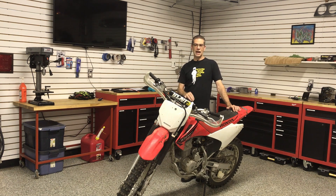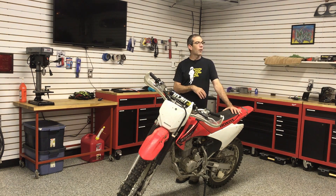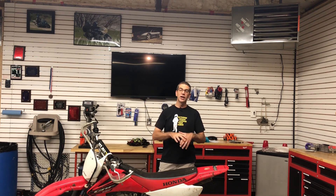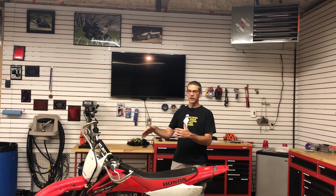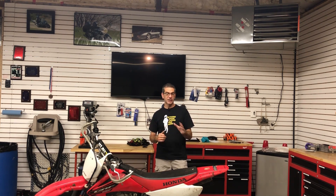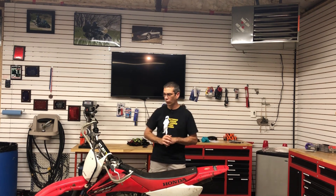The key here is simplicity, and that simplicity lets you focus on your riding skill. The bike does have a rear drum brake, so it's not ideal for locking up the rear and learning to slide, but the drum does a reasonably good job. The bike is small enough that you can practice pivot turns — planting the front wheel and rotating the rear — and it will teach you all of those fundamentals that apply to a variety of other forms of riding.